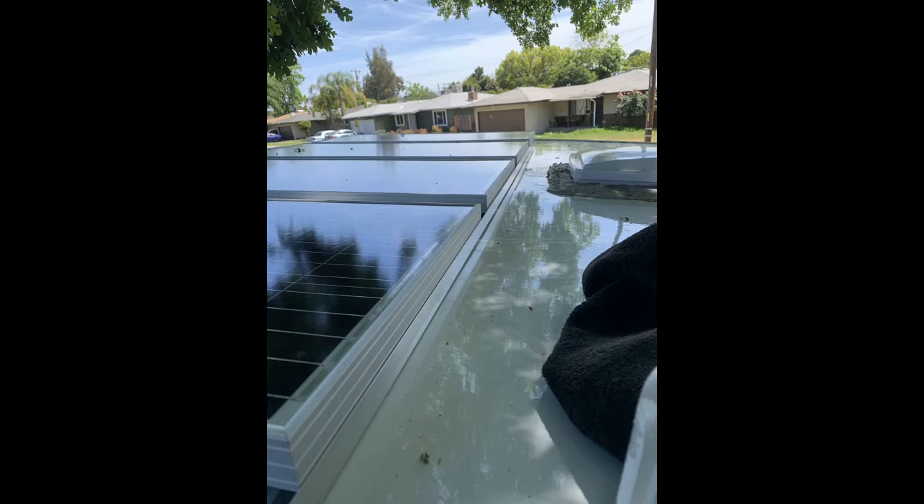On my leading edge — the upwind edge — I put in a one-inch aluminum angle stock strip to keep air from going underneath my panels. With the Terra's tilt-forward design and sloping roof, I used my wind gauge on a windy day during installation. I ended up going with all four panels all the way across rather than two on either side, and I get really great results with the four 125-watt panels — I make more power than I need.